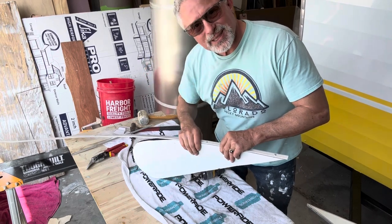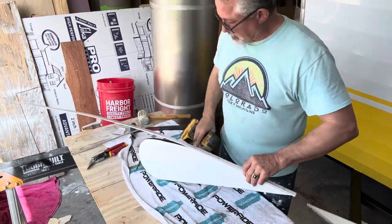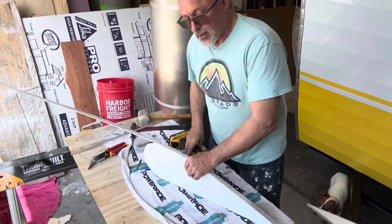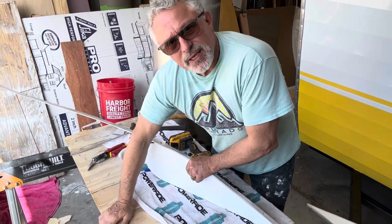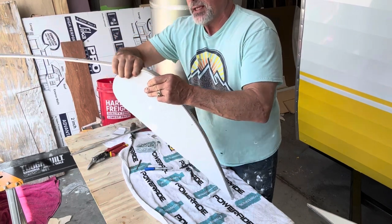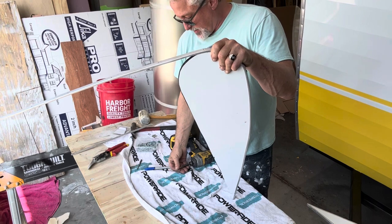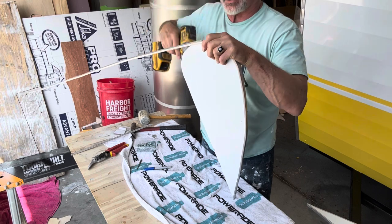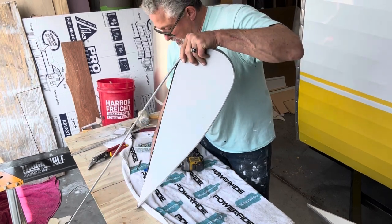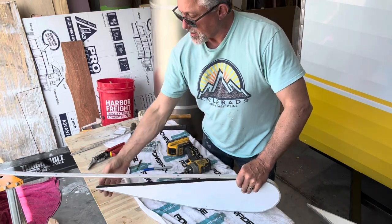It's about time for a double-time on this deal. I'll slow down right here because I want to show you what I'm doing on this curve. This aluminum is just perfect to make these bends — I just slowly work from one point up to wherever the next hole is. I let the other piece stick out a bit so I don't do too much all at once, using it as a guide. Then I move around and make sure I'm hitting right, then get to the next one.